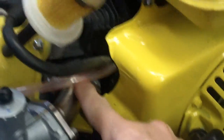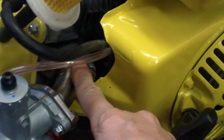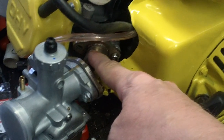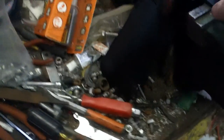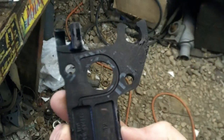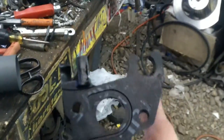Normally right here there's an insulator — I'm just testing things out right now. You need the insulator because the heat from this head will transfer through this manifold, since it's metal, and into the carburetor, and that's not good. Right here is the insulator and this is the way it fits.